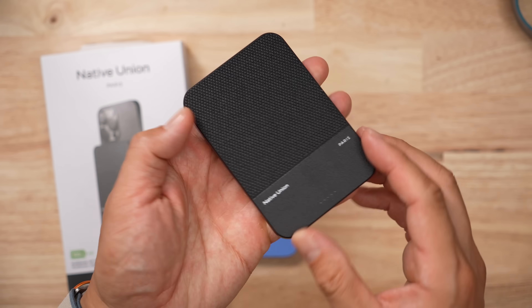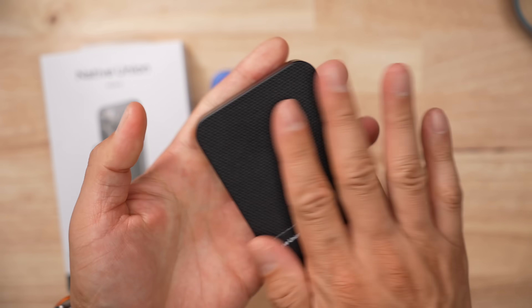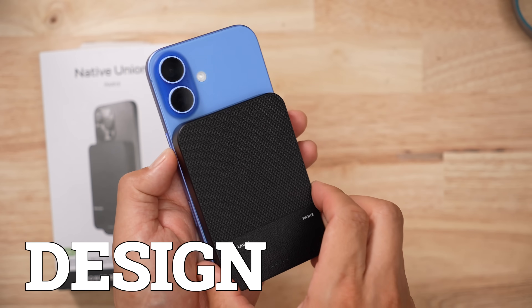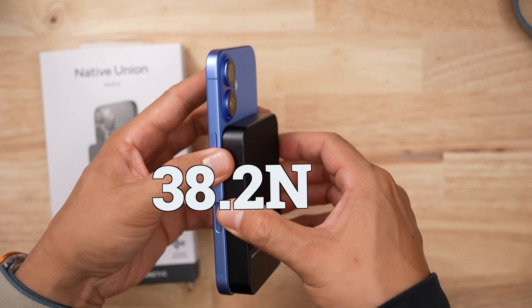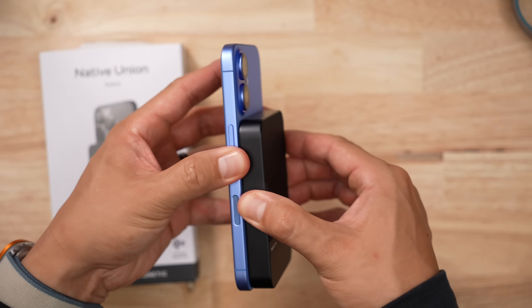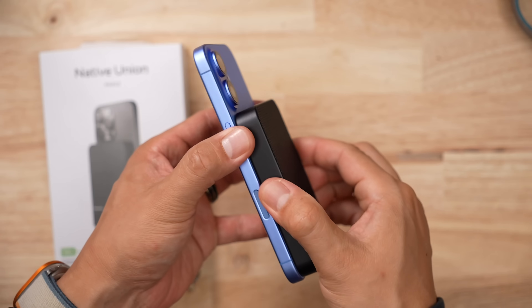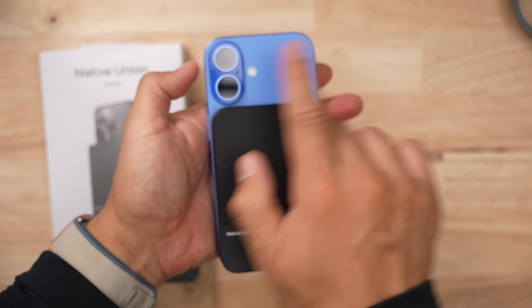One of the reasons why I like this product is the finish. It's got some leather on the back, a bit of fabric, and the edges are metallic — so this is a premium-looking, premium-feeling Qi2 wireless pack. In terms of magnetic strength, it takes 12.4 newtons to push the pack off and a whopping 38 newtons to pull it off, which is way above average. This is one of the strongest battery packs in my test group. I feel very confident doing this without holding onto the phone. It is borderline tough to take this pack off if you're using a normal-sized phone, but that's a good problem to have.